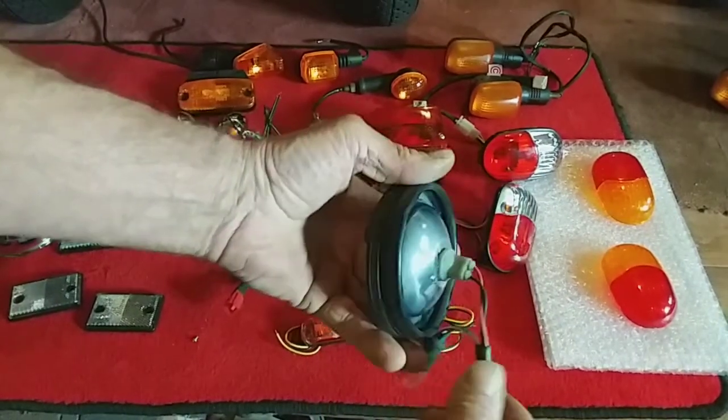Now I need to show you about wiring. This is a front Shop Rider light fitting. The near side and off side are both the same - there's four wires going into three; I'll explain what's happening. What you've got here is your two positives from the light and the indicator joining together, so the positive is going in one side. Then the indicator is the green wire going in and the black wire is the other one going to the lights. All you've got to do is join another two wires on there and you'd have two lights, and it won't affect anything at all.